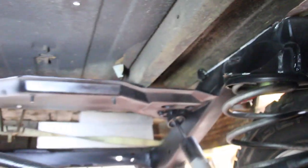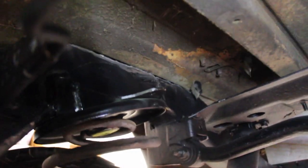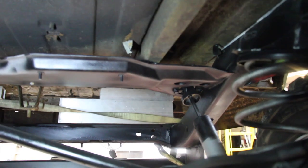Before we make motor mounts and cut up all of the Jeep mounts that we have, we need to mount our Willys body to our Jeep Wrangler frame. In the previous episode, you saw us cut the frame in a few different spots so we could fit the body onto the frame. We ended up using just these aluminum blocks to space the body up off the frame so we can get the right height and then go ahead and make body mounts for our Willys.